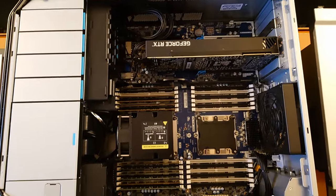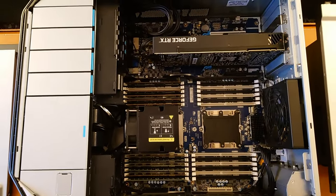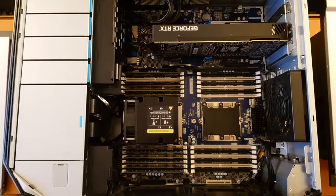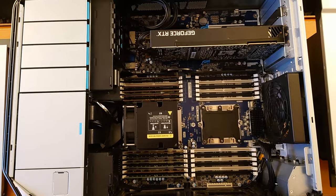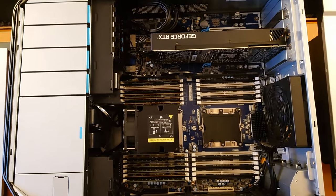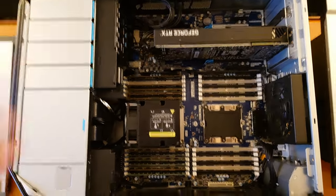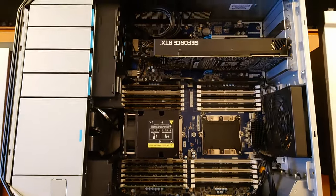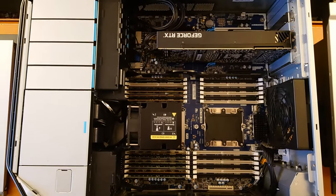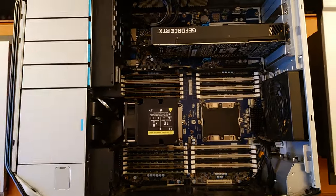If you want to do more gaming on a system like this — although you probably wouldn't buy this purely for gaming — you could get one of the lower-core but higher-clock CPU SKUs. In terms of feature richness: two NVMe slots, up to five hard drives, two CPUs, 24 DIMM slots, plenty of PCIe slots. If you can get one of these systems for cheap — or similarly priced to a Broadwell or Haswell-based Xeon system — I'd recommend going with this one instead. That'll do it for this video. I'll see you all in the next one.